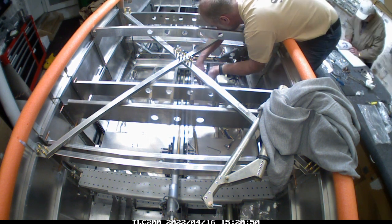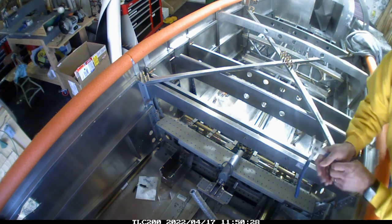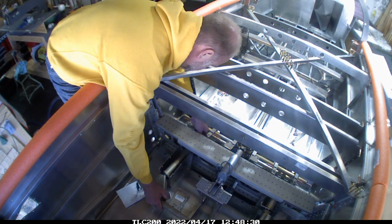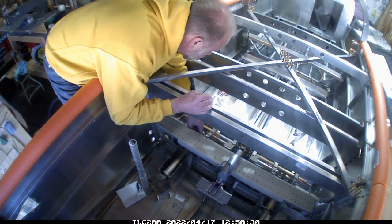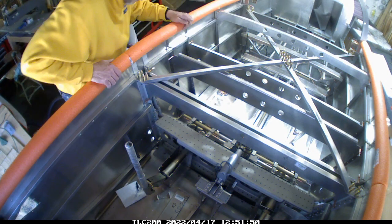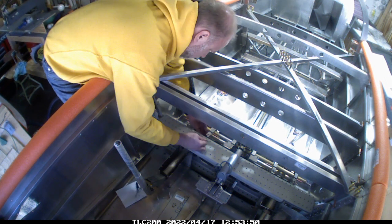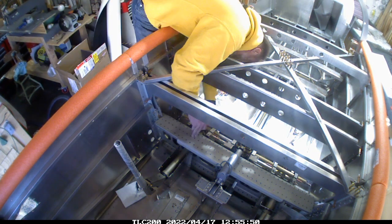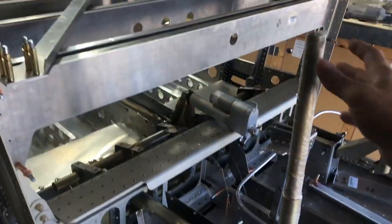I take the sides down in a later video so it's even easier to work in there. Again the control rod comes back out. At this point you might see a sharpie in my hand — I'm getting the placement for the stop rings that go on the control rods so that they are firm in place from forward to aft in the airplane. There are a couple of different times you do this type of locking in of the control rods, not just on the sticks themselves but also on several of the other controls throughout.